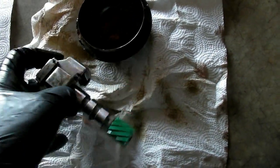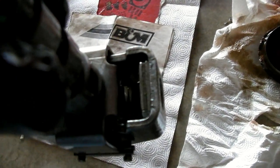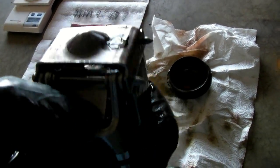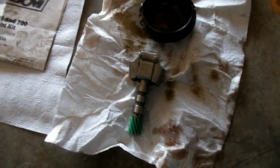Now that I've got the governor out, all you have to do is trim these pins off — just clip them off with a nippers and take the pins out. These are your weights and springs in here. There's a heavy outer weight and your inner weight — that's the one you'll be changing. On the bottom there are some springs. What I recommend is changing one weight at a time. Go lighter if you want to push your shift point higher. There are no real set numbers to go by.